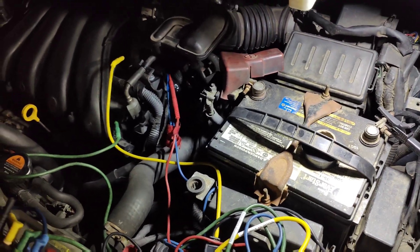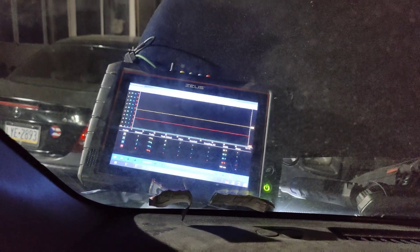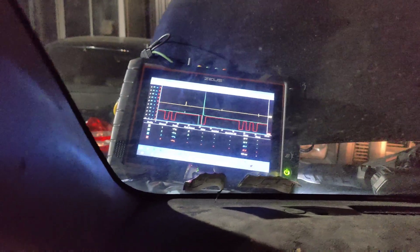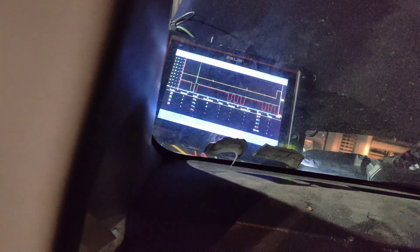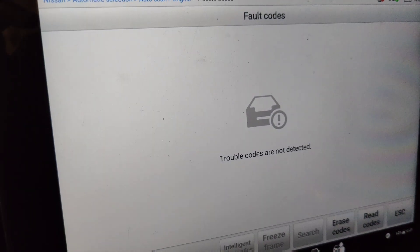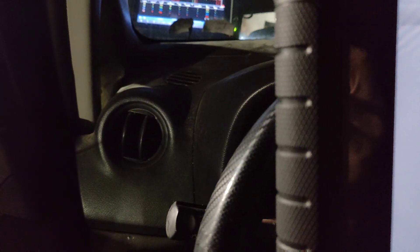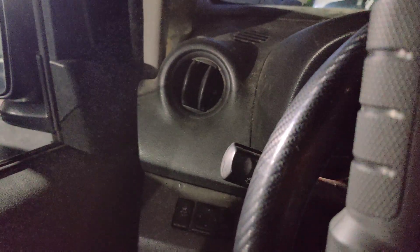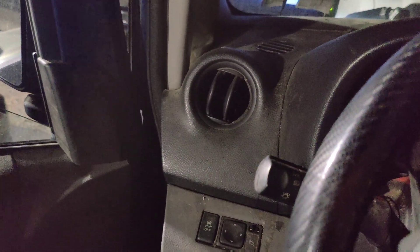Car's running. Got everything put away. I got our lab scope up there. Shut it off, take the key out - look at that, boom, shut it off. Works perfectly now. That's all it was - the ground wire was broken. Scan for codes - nothing. I hope you guys liked this one. It's kind of interesting because they said this was happening before the guy had the motor replaced, they replaced the motor, and it's still happening - because it was that broken wire in the harness.